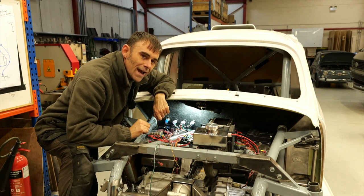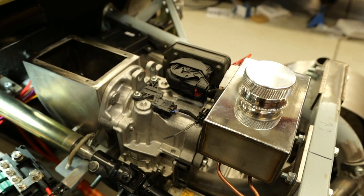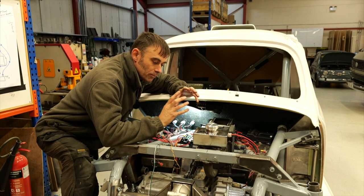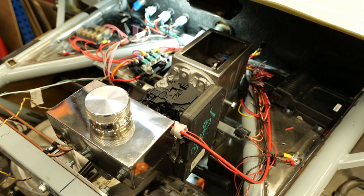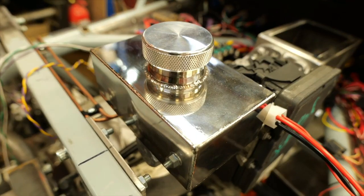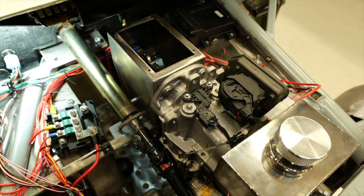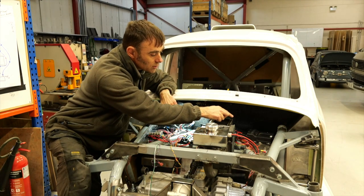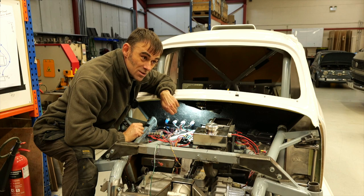This thing in the foreground - brakes are obviously something we're going to have to tackle as far as actuating them is concerned because we've got massive calipers. There are two ways to go: you can either go with a vacuum boosted master cylinder or, like we've done here, an electrically boosted master cylinder. This is an iBooster off a Tesla and we've made our own header tank because usually the plastic header tank goes way out into the distance. So we've got a custom made brake pedal assembly with the iBooster in. All the 12 volts is running to the car now - we've got the EPB ECU, the Tesla ECU, and the EV Controls T2C over there.